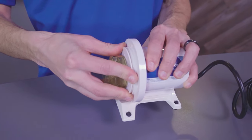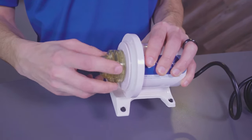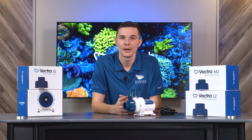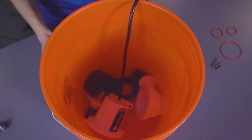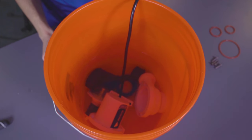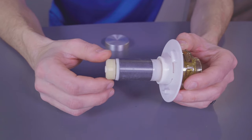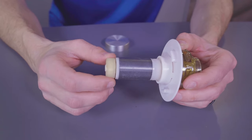Keep in mind while cleaning that the bearing may or may not come out of the pump when the impeller is initially removed. If it did not come out, then you can soak the pump with the bearing still located in the motor. If the bearing does get removed when pulling out the impeller, you can soak the bearing and pump separately. When assembling the pump back together, make sure that the bearing is installed in the correct direction as previously shown.